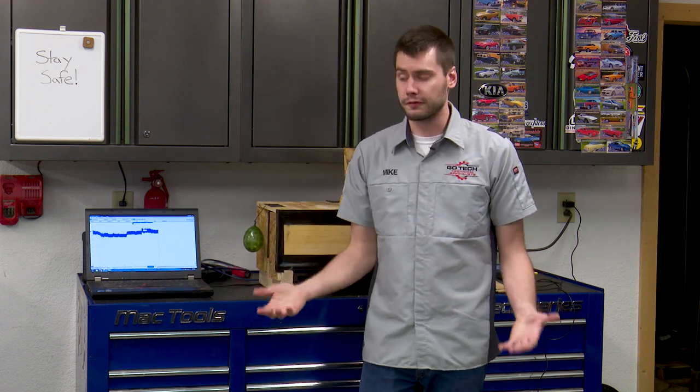Alright, so there's the proof — the proof of concept. We had the tools to do it. Test, don't guess. Again, I'm sorry for sharing that inaccuracy yesterday. In the event of a restricted cabin filter, the current will go down because we're not flowing as much air. And because we're not flowing as much air, the resistor can overheat and cause that thermal fuse to go bad, causing the resistor to fail.